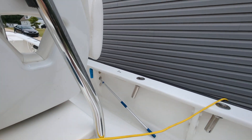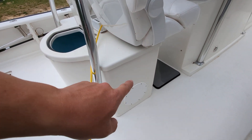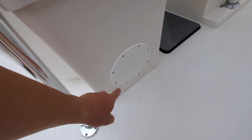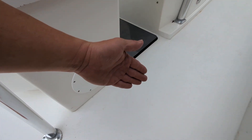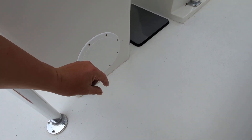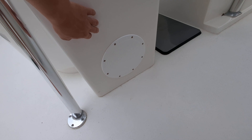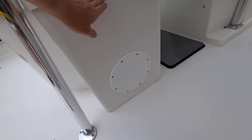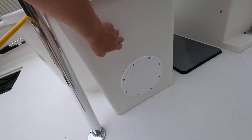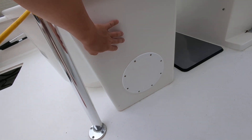If you look at that when the sunlight is perfect, you'll see there's a single layer of glass — you can see through it. So when I pressurize my live well, I started getting a lot of water in my sponsons. Inside your bait well right here, you can take these screws off and what you'll see is the deck joint right here — where this piece of Coosa comes in — there is a half-inch to three-quarter-inch opening. That joint, this bait well lid, isn't fully sealed, so it's pressurizing over into the interior portion and getting down and flowing into your sponson.